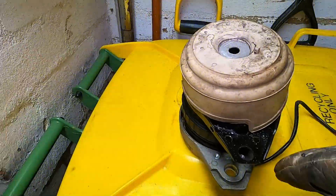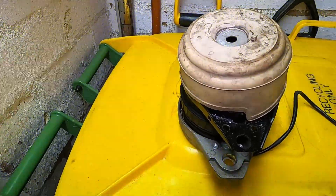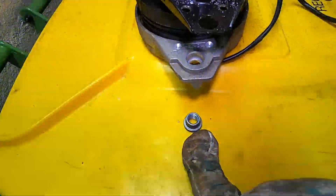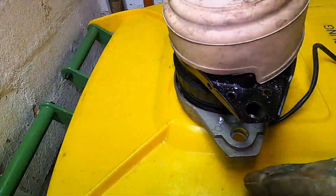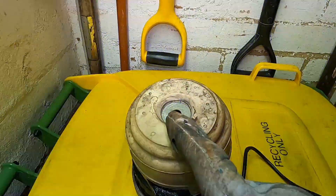To get this apart it's pretty easy - drilled out a couple of rivets on each side and took out this nutsert which is pushed in to hold it down to the subframe and then on the top of the engine mount.